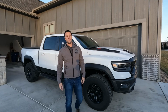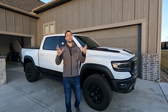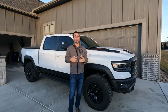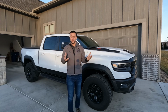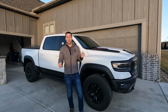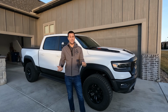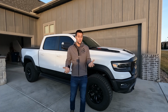Well guys, as you saw, I didn't really film too much of the reinstallation of the cylinder head and the supercharger because it would have just been outrageously long, and it obviously was already really long just on the time lapse of the teardown. But you at least saw the process of airbox and supercharger and valve cover and cylinder head all coming off this thing. We got to look at what we found, and like I said, I'm pretty sure it was just loose or under torqued head bolts.